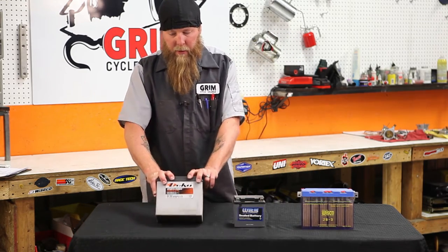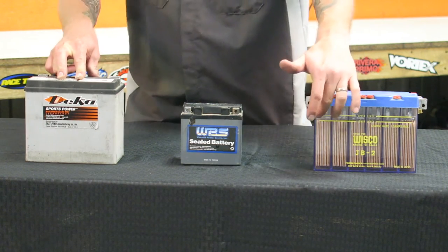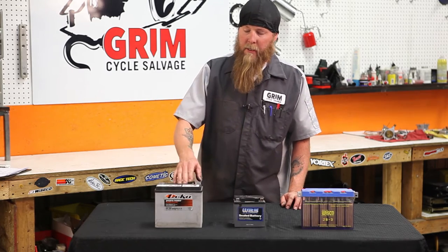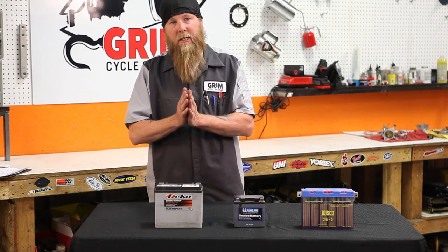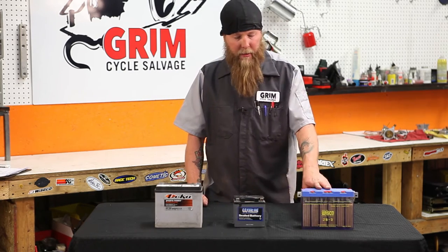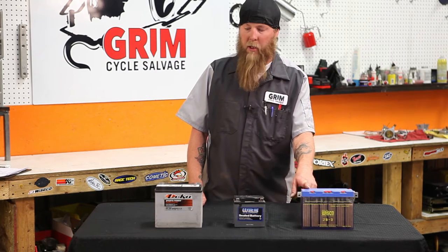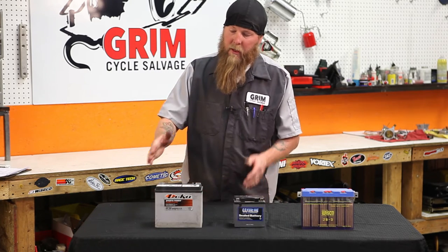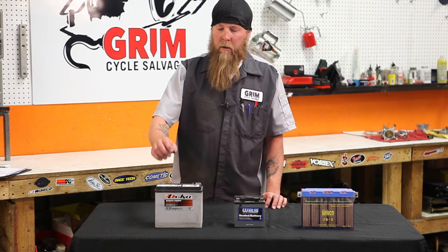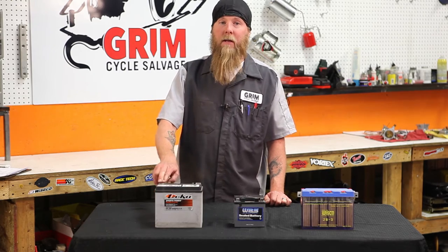The next in line, and definitely the one you're probably going to use most often in a bigger bike like your Harley, is the absorbed glass mat. This particular brand is DECA and it has the same sort of plate construction inside, but the major difference is a full molded case construction. They are maintenance free and they come activated from the factory. The absorbed glass mat — when they inject the electrolyte into it, the mat absorbs and expands. The plates are packed nice and tight to help reduce vibration. In a cheaper battery, especially in a rigid or big inch bike that vibrates a lot, the plates separate and short out and that's when cells go bad. Good quality batteries like this are designed with molded lugs and solid plate construction to help reduce the possibility of the internals coming undone. The absorbed glass mats can be turned in just about any direction, have really high cold cranking amps, and typically, if well maintained, you get three to five years out of them.